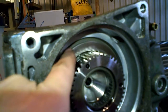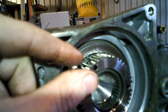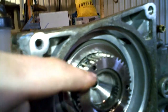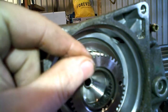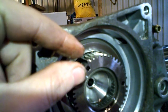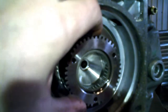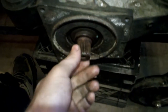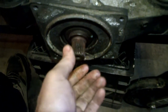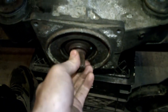This is a bearing, by the way, and it just compresses the clutch pack, so that I will talk about later. This section is mating with the clutches, the 2 different clutch sets, and it will spin another shaft that goes here normally, that is just splined in there on this shaft, so that the drive shaft just gives its power to the rear differential.